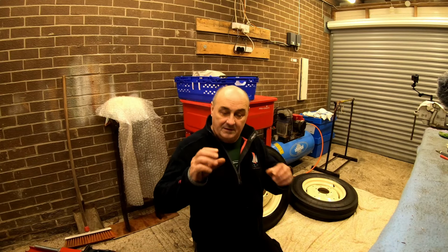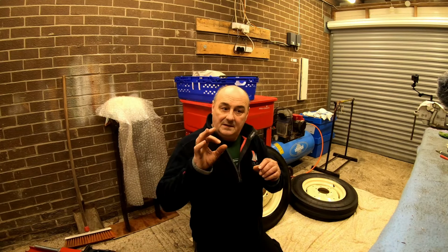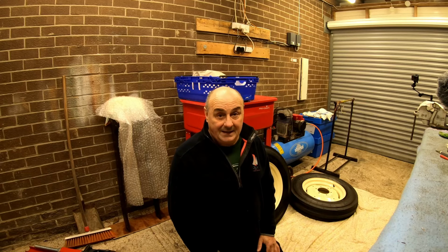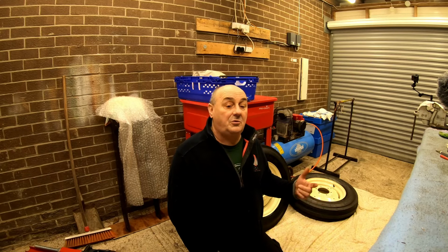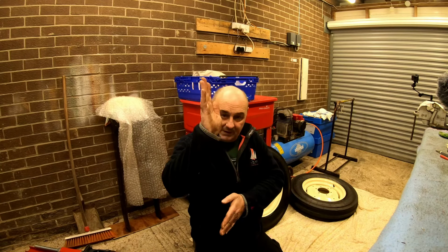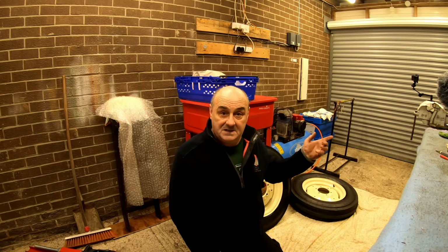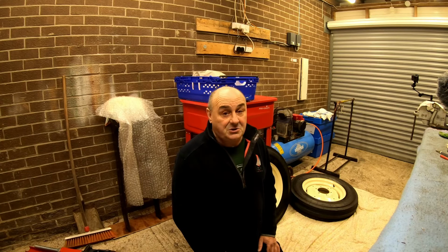That camera's just died. So in the picture, you can see where it's been welded, and the little bit in the middle of the picture is the only bit of weld that actually stuck to the rod. Luckily, the rest had just been sticking to the actuating cam. So it snapped. So I put it back together the way it was there, but it's not the correct way. The correct way is 6 o'clock, handle up, cam down. That's the correct orientation for that piece. So we'll fix that. So what we'll do is we'll fill the hole with weld, we'll put it back together in the correct orientation, and we'll re-drill the hole and just pop a pin in there and get it fixed. So it will be up and running as it's supposed to be.